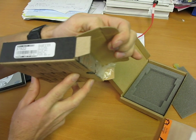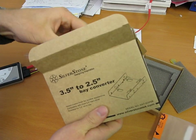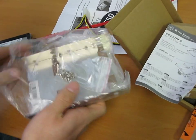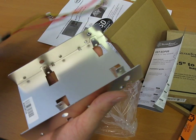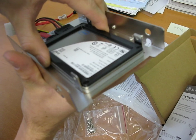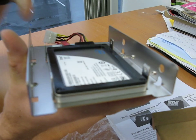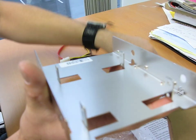This is the — I can never remember this — the SDP08, and this is widely regarded to be one of the better adapters out there just because it's got a very solid steel construction and you can actually mount two SSDs in here. You mount one at the bottom and you can stack another one right on top of it, so you can do two SSDs in the space where you would normally have one normal hard drive.